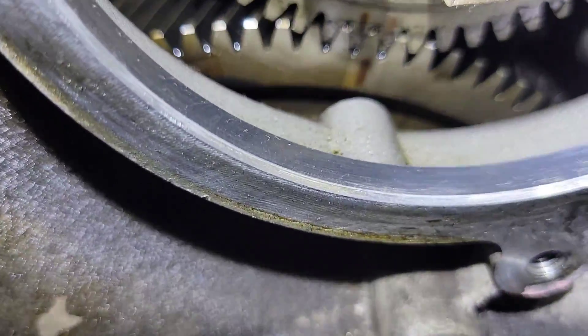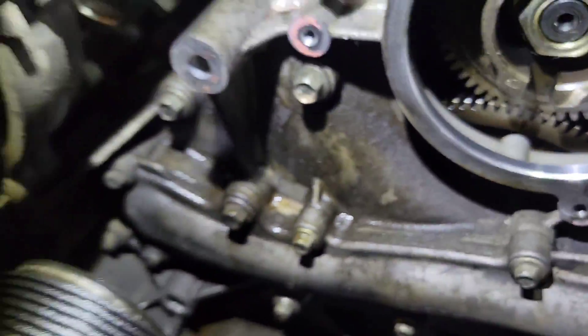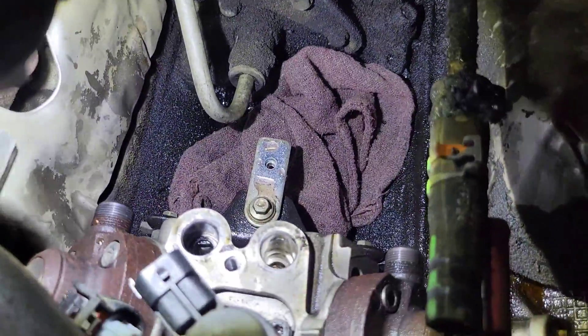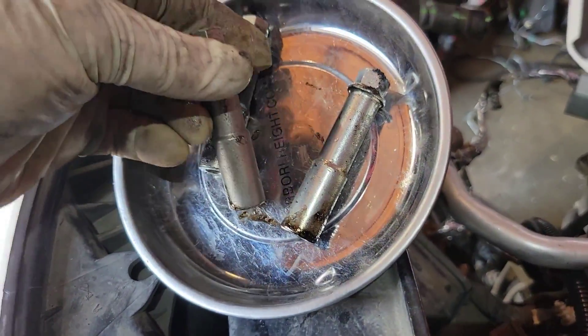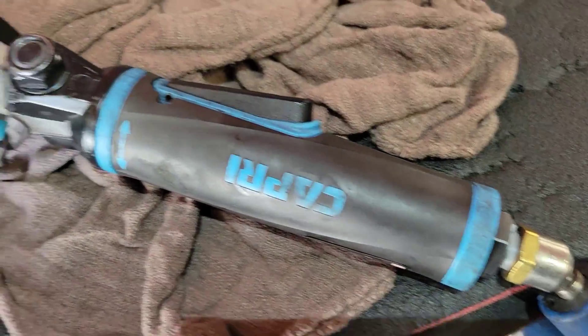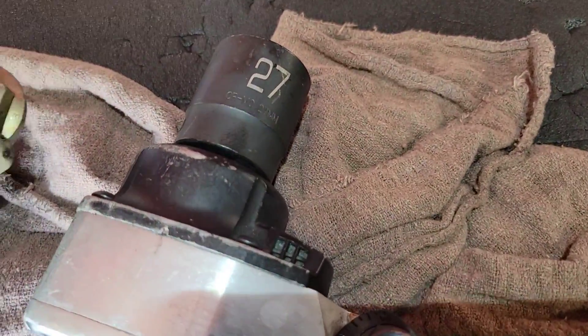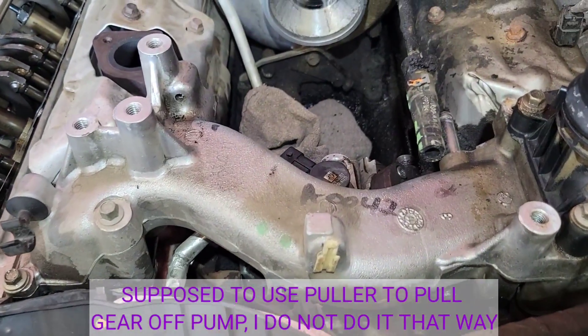You can see the single mark at the bottom and the two marks at the top — that's where the vacuum pump goes. Now get this bracket off and unbolt this pump. This is what mounts to the back of the pump, three of those. In the front you just have the gear and the nut — it's a 27mm. I used my Capri flex head half-inch impact and it zapped it right off. Wiggle the pump side to side and pull it out.